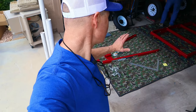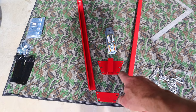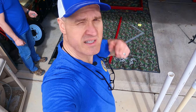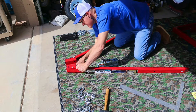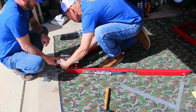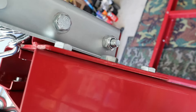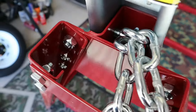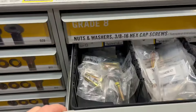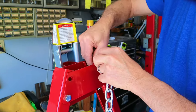Next, we're going to put together the front tow bar assembly — this is how the trailer is going to attach to your vehicle. This thing only has five or six pieces: the two tow bars, the T-plate, the bottom mounting plate, the hitch coupler, and the safety chains. I don't care for the way the instructions call for the safety chains to be mounted — it's one long chain through the center link of the forward bolt. So I'm cutting my chain in half and using two grade-8 bolts from Lowe's for $4 to have two separate attachment points, which I think will be much stronger.